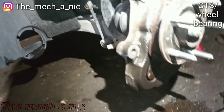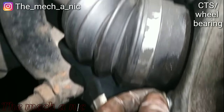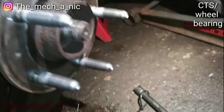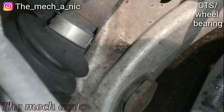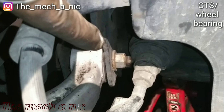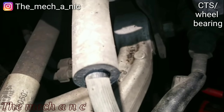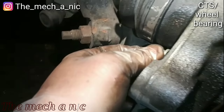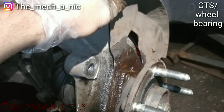Here's a 2008 Cadillac CTS here for a wheel bearing. This thing is being a major pain to get out. I had to resort to putting this on one of the bolts coming out the back of the wheel bearing, then wedge it on the subframe and use the rack and pinion to help force out the wheel bearing. Now it's just air hammer work — that's a good sign.